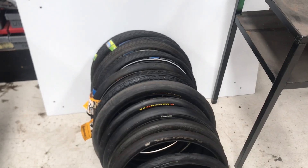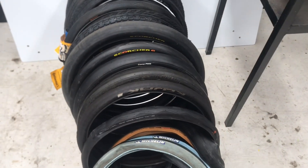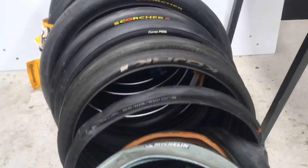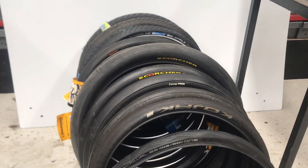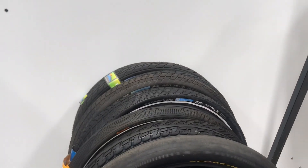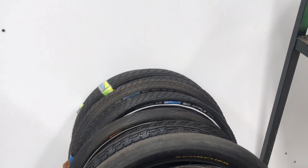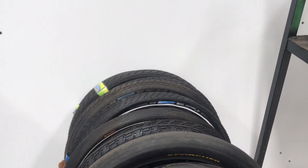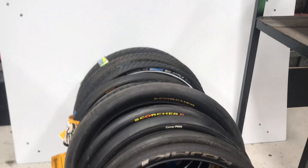We have quite a huge selection of tyres here. My decision in choosing what I have chosen is to give a selection of what I would call fast, performance, time trial, or racing tyres; intermediate tyres, which are good for commuting and for fast riders; and trail tyres, which are tyres you'd predominantly use on bike trails. The idea being that if you're not primarily choosing a tyre for its speed, you can at least take an interest in its rolling resistance and maybe choose the best rolling resistance tyre that still gives you the properties you're seeking.